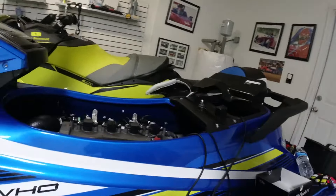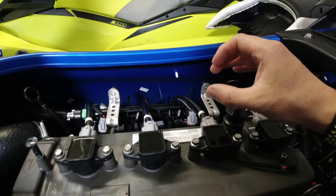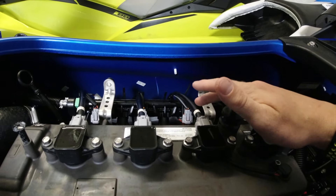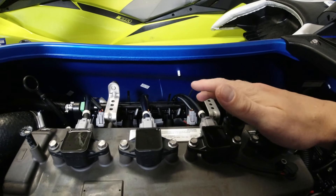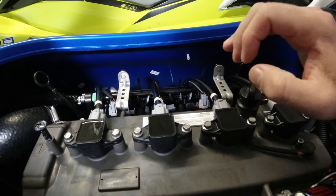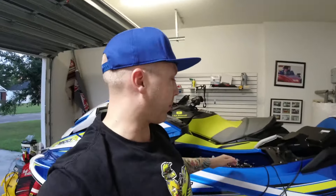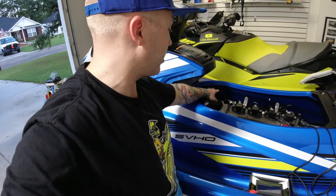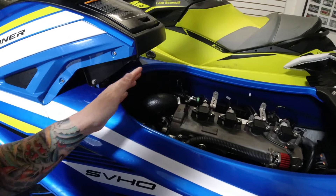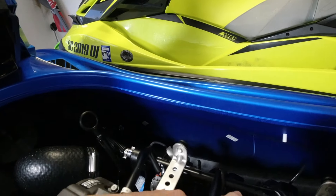What's crazy is in the intake manifold, they have this like ribbon that's in there. On the 2017s you can just pull it out and stick the new one in, but on the 2018 and 2019s you'll have to pull the intake manifold out. There's actually a drill to drill this piece out and it's real restrictive. That's probably the route I'm heading next. And from what I'm aware, to pull the intercooler out you have to pull the intake manifold out, so that's kind of the route I'm heading.